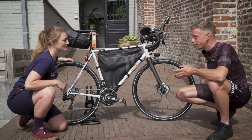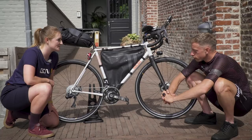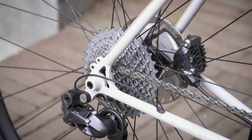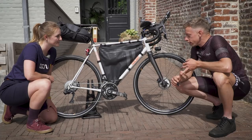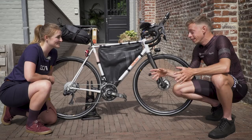In terms of gearing, it's not your usual setup. What have you got running on this one? It's not about top speed — it's about the best average speed and having the right gearing for any section. We're going along flat stuff, up mountains, and also riding really slowly after five days. You don't need a 53 and you definitely don't need an 11. So I've got a 46-34 on the front, which gives a nice chain line.